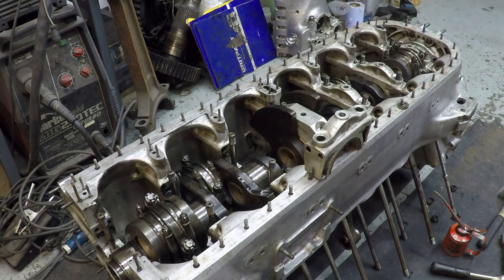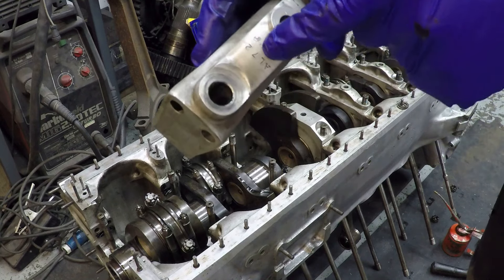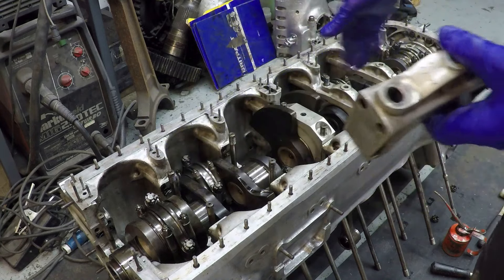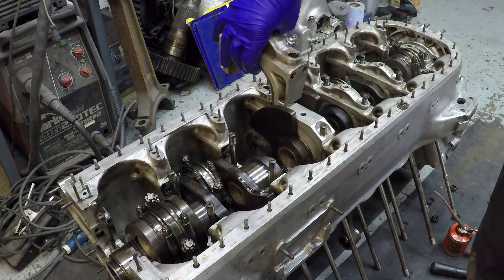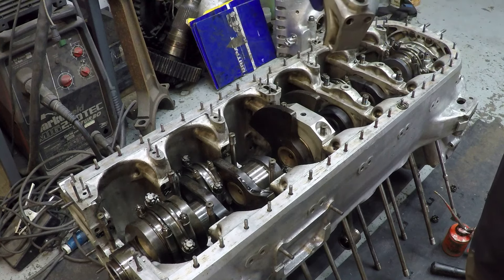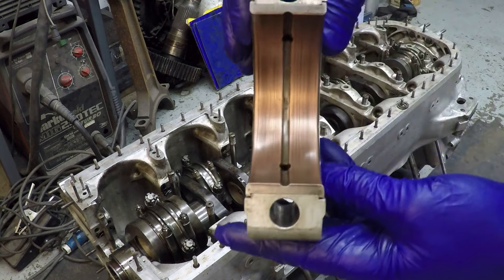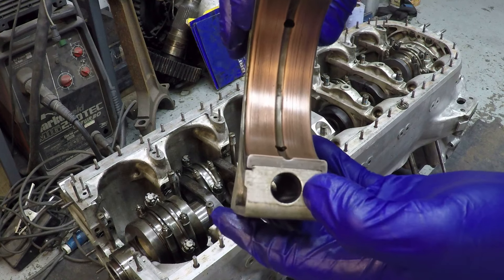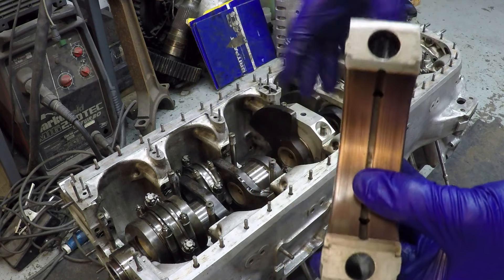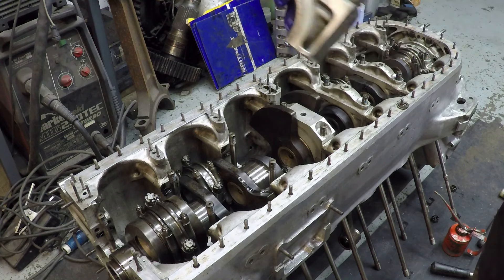So I've got up to number four. They've also got AL-72 marked on this one, marked onto the side of the crankcase, which tells you which way around to fit it. It's got the bearing journal number on it as well, so it makes it much easier to assemble without having to mark things up yourself. If you look at the two holes in there, one is smaller than the other because there's a larger diameter section of the bolt down there — that's acting as a dowel, an actual location point.